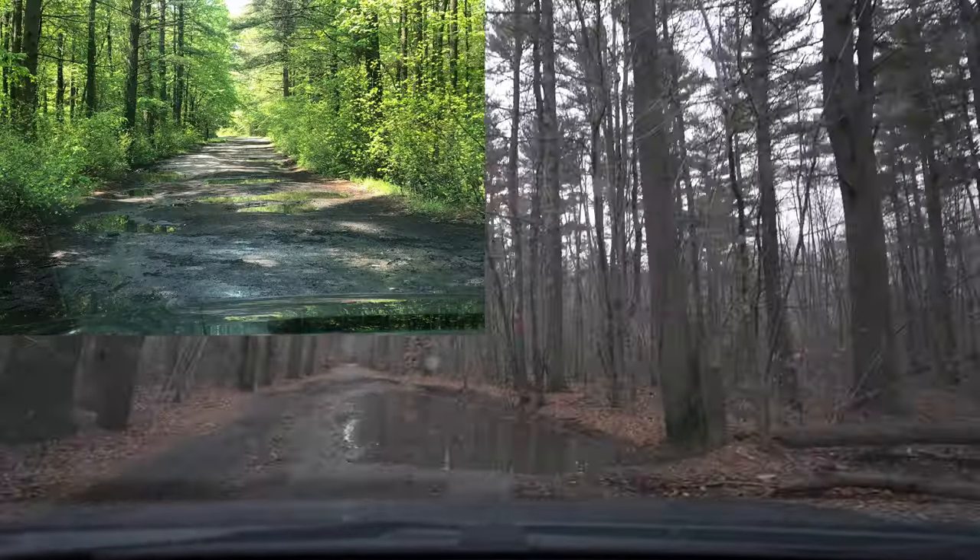These are directional tires — only face the V-tread pattern forward. When you rotate them, you simply move two from the front straight to the rear with no crossing due to the directional pattern. Some people worry that the same tire always does the same turns, but with good maintenance I've seen no uneven wear on the cornering sides. Nothing.